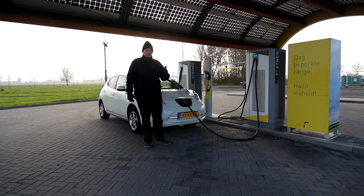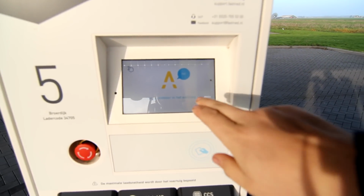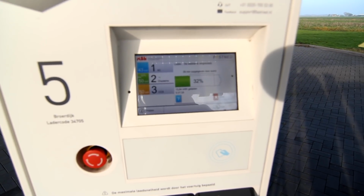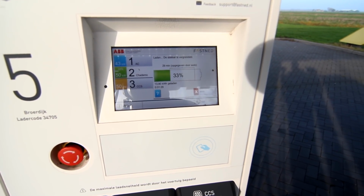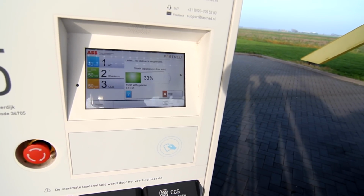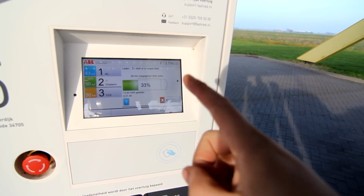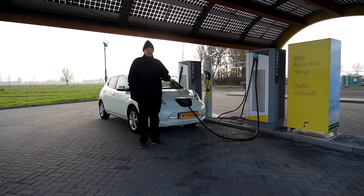And then we come to the charging. I've promised on muxsan.com that the car will charge faster. Now, as anybody with a Leaf knows, right around freezing, as it is now, the car will charge very slowly, like at 15 kilowatts on a 50 kilowatt DC fast charger. And that is what my car is doing right now. It is charging very slowly, around 22 kilowatts, even though that battery in the trunk of my car should be able to accept much more. The car doesn't quite understand that it should be able to charge faster.